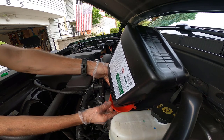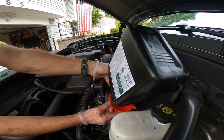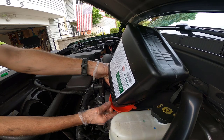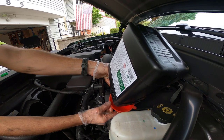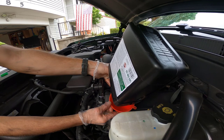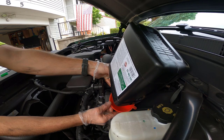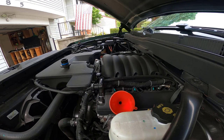For the next container I'm going to go to half, so that'll be six quarts total. We already put a little bit in the filter, so I'm going to go to six, six and a half, see if I get a reading on the dipstick, and then start topping off from there. The last thing you want to do is overfill it, because then you've got to start draining or sucking it out — nonsense you don't have to go through. Alright, that's good enough. Cap that off and get rid of it.